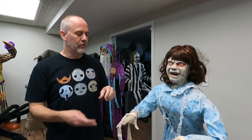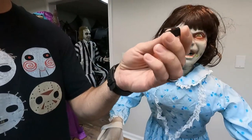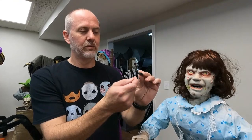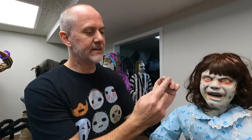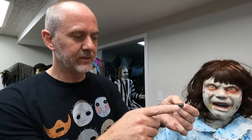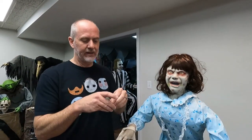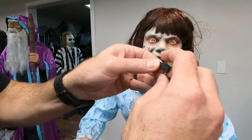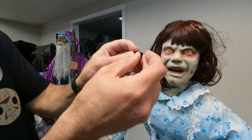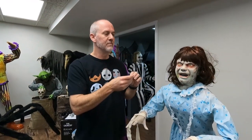This is a lever type. On the limit switch — this is what a limit switch looks like. On the motor, what happens is there's a part that pivots. As it rotates around and it goes to where it's going to stop, it makes contact here and it stops. This is what tells it where to stop. The switch will go in a circle, it'll lift up one side and push down. And that's what makes her stop, like she is now. What was happening with her is the limit switch was not operating correctly. You see the red button here — when it presses down, it makes contact here. So what was happening is it was making contact but it wasn't stopping. It just continued to go, and that's why she was looking like she was actually possessed.